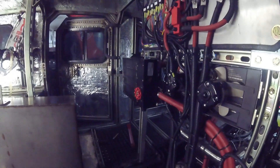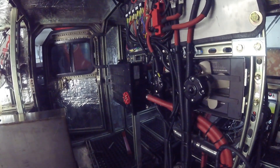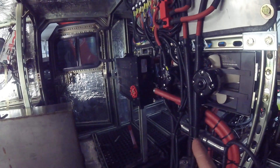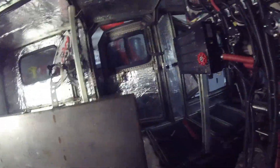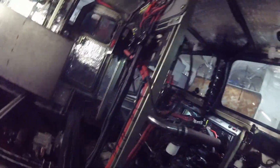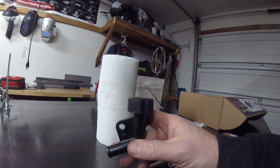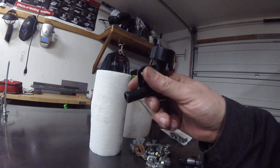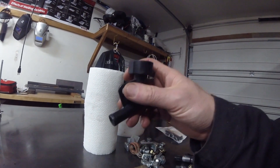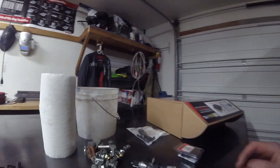One of the things I want to work on is these heaters. They put out a tremendous amount of heat. But it will allow me to put a T in there somewhere and then put this up at a high point so that I can fill very slowly — because this is half inch — the cooling system, and there won't be any bubbles in it. I can bleed the bubbles off through a funnel up here, so that's one thing I want to knock out.